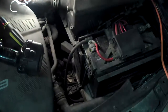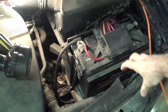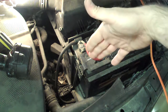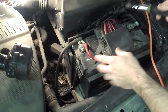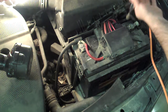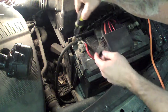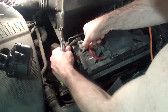The repair is actually fairly easy. You start with removing the back of the light here. You need to basically remove the entire battery area in order to access this contact — it's pretty hard to reach. Before you get anything done, the easiest way is to actually disconnect the battery first. Loosen up the nut — you don't have to loosen up the nut on top of the plus, just the bottom. This is what actually releases the connector.